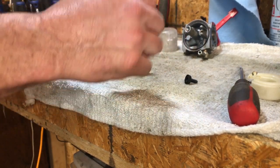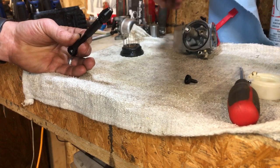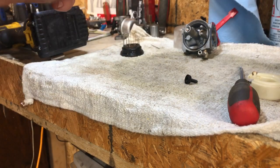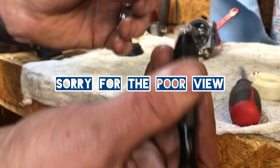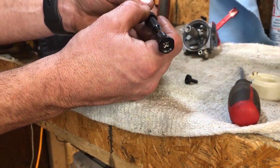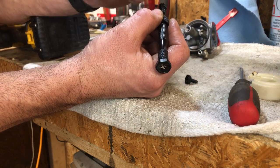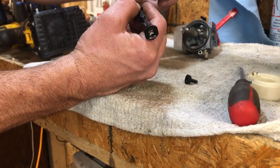What we're going to do — here's one I used not long ago, probably on an ATV. You'll usually get the proper jets going that route. We're going to go right into this orifice here with this drill bit. I just let the jet itself kind of do the work. I'm hoping I don't go too far. Usually you find the bit that matches the hole perfectly, and then you just take the next drill bit size up.